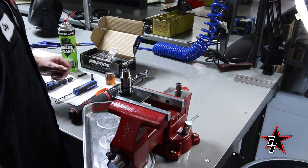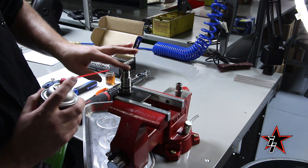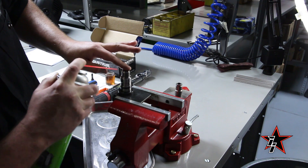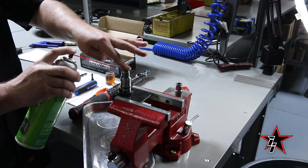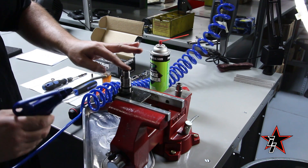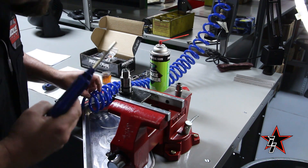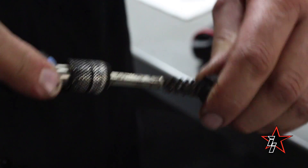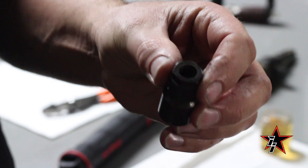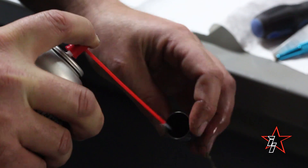Now that the nozzle is off, I want to ensure there are no contaminants on the mating surfaces of the nozzle and the injector. I put my finger over all the small parts and give it a light spray of brake clean to clean it — this knocks off any extra carbon or debris that may have fallen onto that plate. Then I do the same with a light blow of compressed air to blow it dry, making sure it's clean and oil-free. It's important to get all the carbon out of there; check on the inside and make sure there's no carbon remaining.